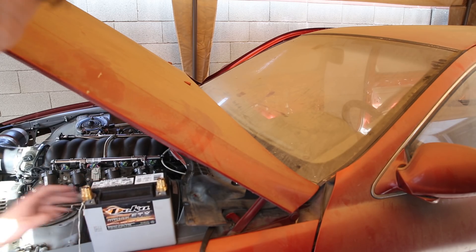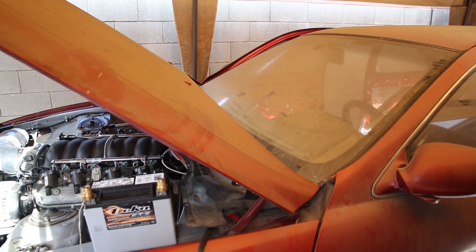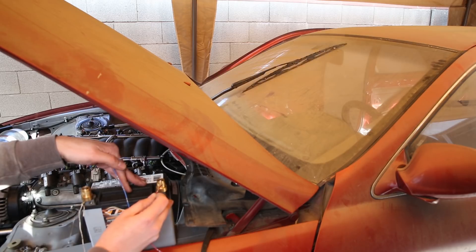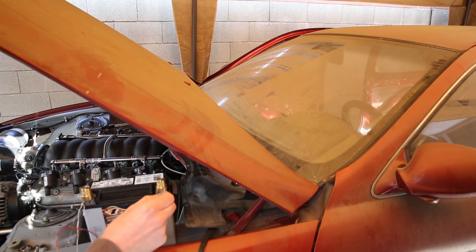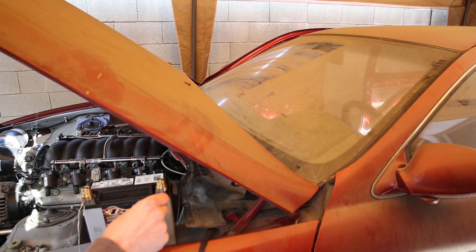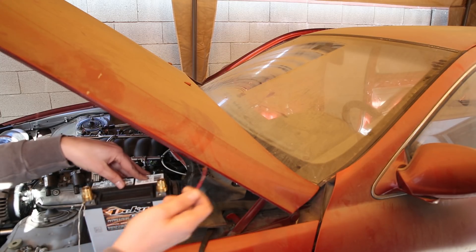I don't have the ground wire to the negative on the battery, so hopefully when I touch these other wires to the positive terminal we'll see the wipers do something. I took off the driver side one so it's just the passenger wiper. It's pretty fast and very dirty - the red and blue stripe seems to be pretty quick. Blue with the red stripe is slow, blue with white stripe does nothing, solid blue also does nothing. So red with blue stripe seems to be the winner.